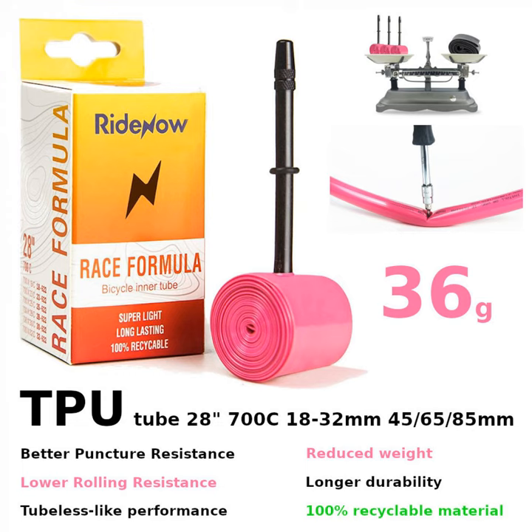Edit: after hitting the edge, the tire actually burst, but luckily the valve remained intact. The process of patching a TPU tire was now tested. The only difference when patching a TPU tire is that the area needs to be thoroughly cleaned with an alcohol wipe — included with the patch — for the instant adhesive to adhere well. According to the instructions, the instant adhesive should be left for a minimum of 30 minutes before inflating the tire.